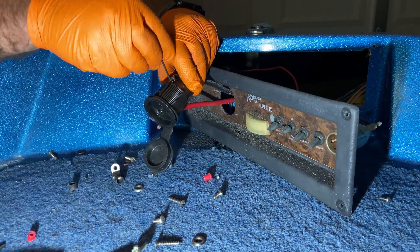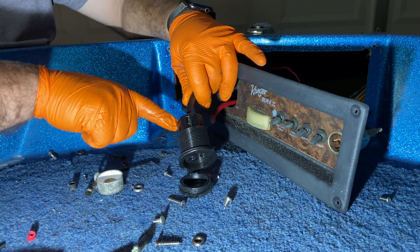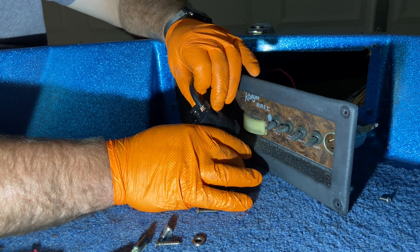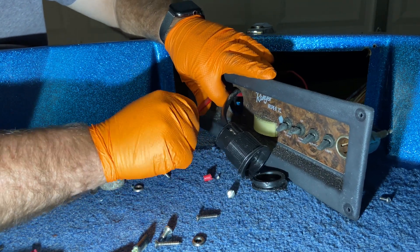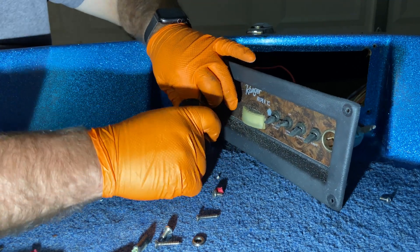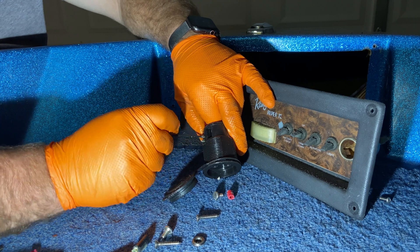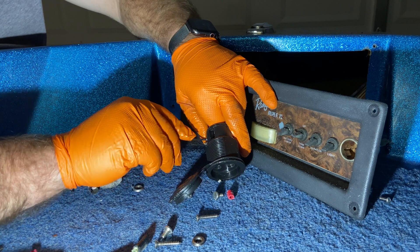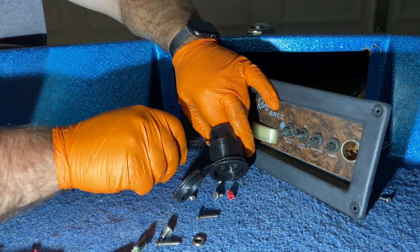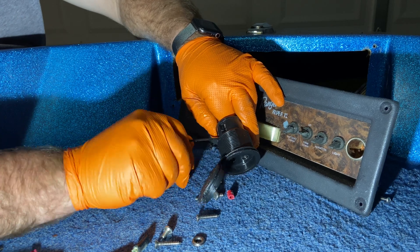They've got two set screws. Any time I do an electrical connection like that, I want to make sure it's in there solid — give it a good hard yank to make sure. Now that we've got our negative in, we're going to put the positive wire in. I like to give the wires a little bit of a twist to help them hold together. The dielectric grease prevents corrosion, which causes higher resistance in the circuit — you get less amperage draw and more heat. Higher resistance causes heat, so wires can start to melt. You definitely do not want any extra resistance from corrosion, and that dielectric grease helps with that. We like to use it on all our electrical connections when we can.